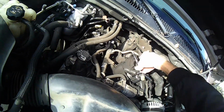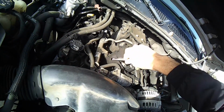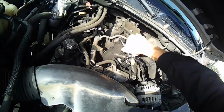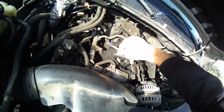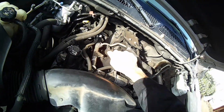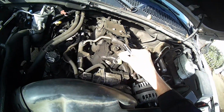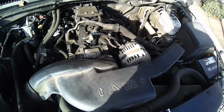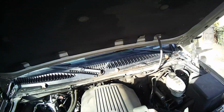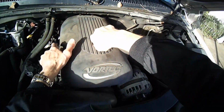It wasn't able to vent off those fumes. And there is another culprit that could be causing the trouble. It's down underneath the car above the transmission housing, and there's a little solenoid down there too that could be trouble. But the gas cap's the most likely, this is second most likely, and that one's the third. So that's on tight, this is on tight, the electricals are on tight, and we're all set. And we're going to put this back on. We're going to feed these into the rubber grommets back there, set it down, tighten up this 8mm, and we can test it out.